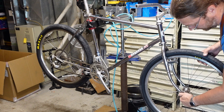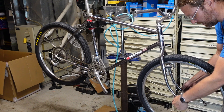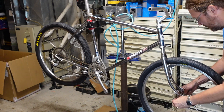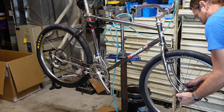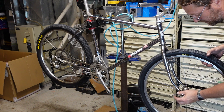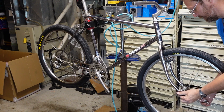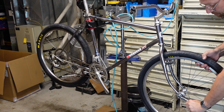I've got these washers with a little tab that fits into the fork. Except I didn't get this one in the right spot on the other side, so I get to start over. If you have these washers with the tabs, theoretically if the axle nuts were to loosen up a little bit, it buys you some time before your wheel falls off. Now on forks they put a little lip on the bottom — we call them lawyer lips. I'm sure somebody got sued about a front wheel falling off at some point. This is a pre-lawyer-lip bike — it was made in 1987.